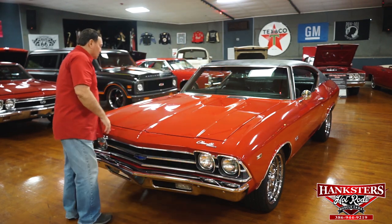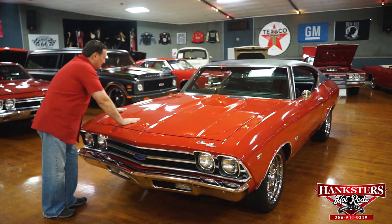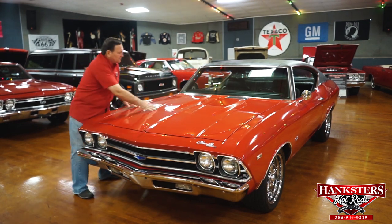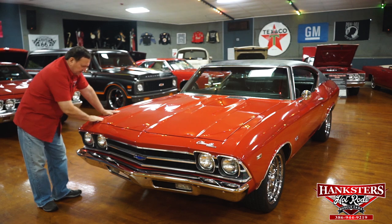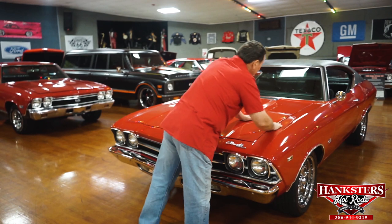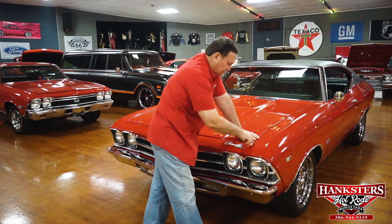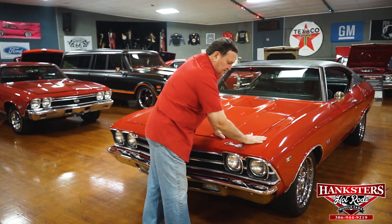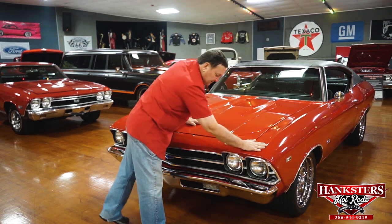The paint on the car is really nice. It does have the double-bulge 1968-69 SS-style hood. The chrome on the louvers — which is usually deteriorated — is absolutely brand new. The fitment of the hood is very nice on this side; the gap is real straight the whole way across. On the other side it's about the same, though this corner is up just a little bit. I'll need to turn the stopper down so it drops a little — just a fitment issue on our end, not a problem.